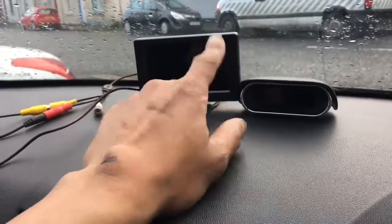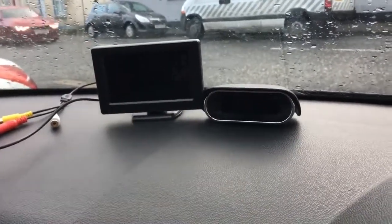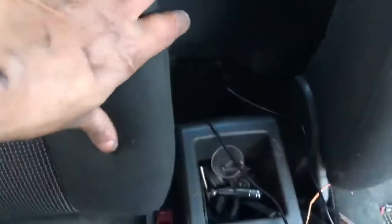This other cable goes all the way to the back for my parking sensors. This is an 8-sensor set, however because the cables are too short I only connected the rear ones. On this car you're going to run cables all through here, under the back seats. Remove this panel here — cables go through there, and there is a little hole on this car which allows you to put the cable through into the trunk.